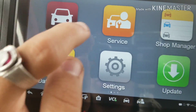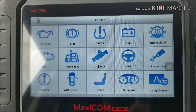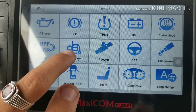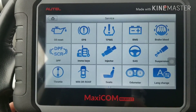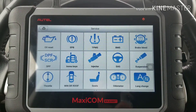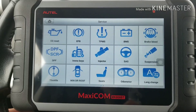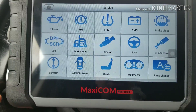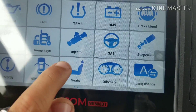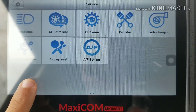You also have Services, where you can perform a bunch of services. For example, if you've installed new tire pressure monitors, you can go to TPMS and program them so your car recognizes the new monitors. You can also program keys — I programmed a Nissan Altima Intelligent Key and it worked flawlessly. The only drawback is that some menus are not labeled clearly enough, but otherwise it functions well. You can also do brake bleed if your car's system supports it.